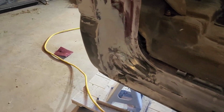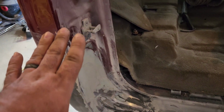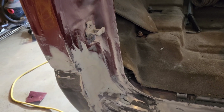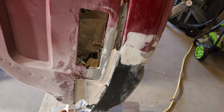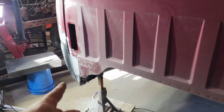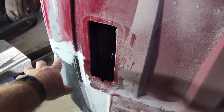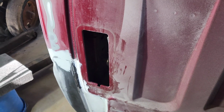So that's good. We did stick the panel bond here and there where those places meet, and we worked all through here. Got a lot of work done in here, forming up these cab corners back here because I cut out that big spot. Wouldn't have had to have done that as much if I cut it correctly. Remember, that was all my doing. Put panel bond in here and on the back side through there, and I went ahead and just put expanding foam down in these corners. The factory little foam piece that sits inside here to keep rainwater out of the vent and stuff like that.